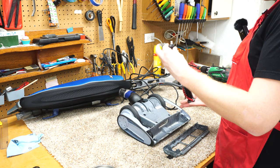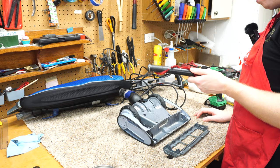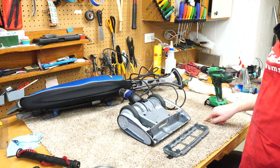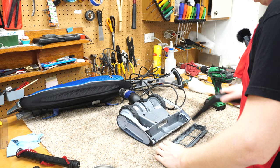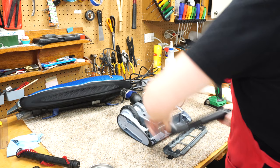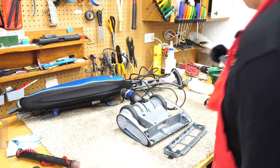I'll put a link below to what parts I can. Your brush roller should spin freely. You can get to one end cap, but you cannot remove the other end cap. Keep in mind this is a wear item — you want to change it probably every two to four years on this machine. Build-up like this is pretty normal inside. There's a really quick way to get rid of that — check out my review on the central vacuum if you're wondering what kind of machine I'm using. As you can see, that gets it really, really clean.